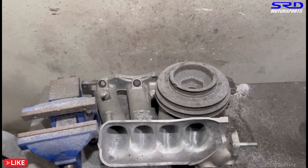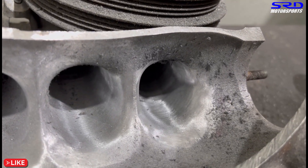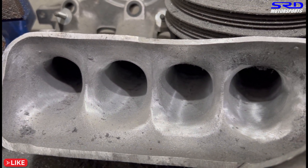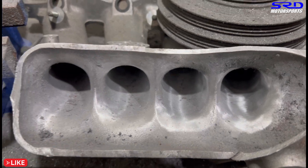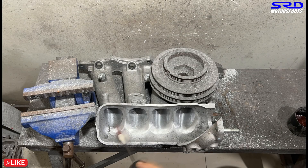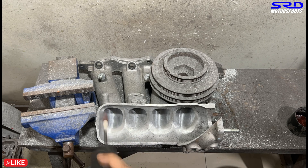Let me show you close. Look at that — and that is still 80 grit, guys. Now we continue but this time with 120 grit. As you can see it's starting to get lighter — that's actually because it's 120 grit, it's a lot smoother, but it's still kind of a dull finish, not ultra shiny but smooth. That's good. Continue this with the rest of the runners.